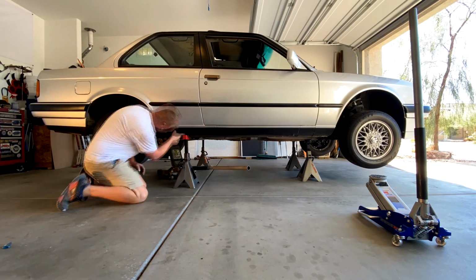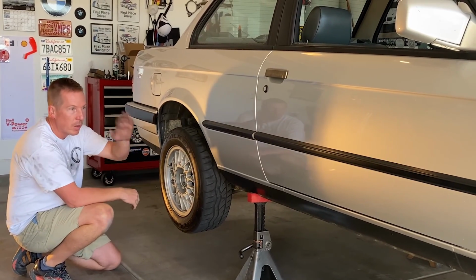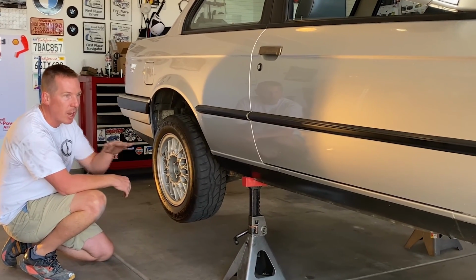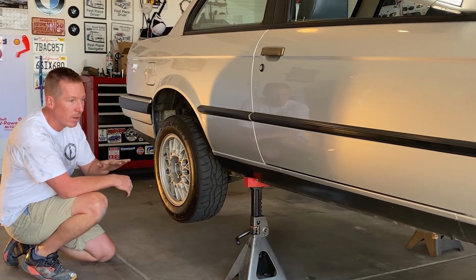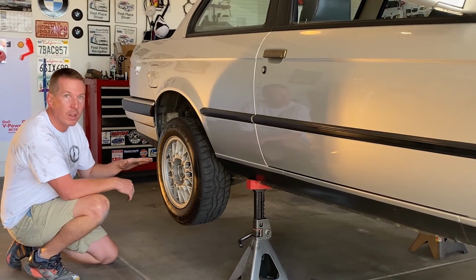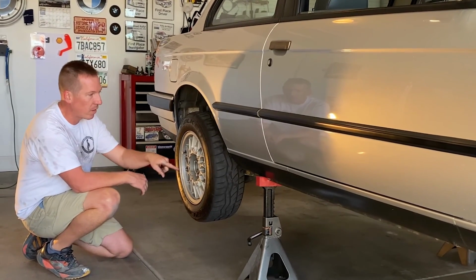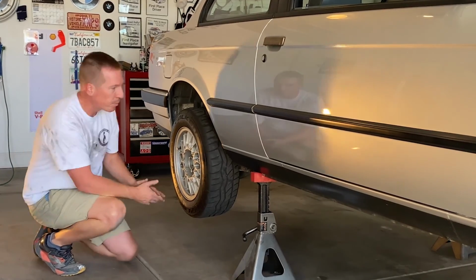Okay, so we just finished raising the front and the rear. So, long time lapse, but you'll see the time that I put into double checking that, making sure that everything is safe. Your head's under this car, your body's under this car. Triple and quadruple check with these jack stands. I use 6-ton Harbor Freights instead of 3s. I enjoy the safety of a 6.